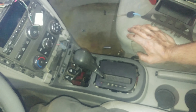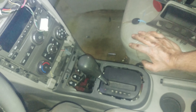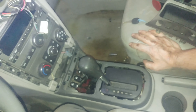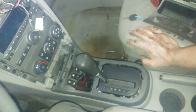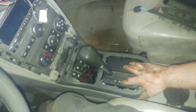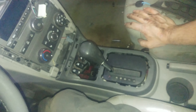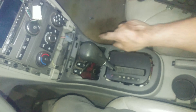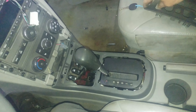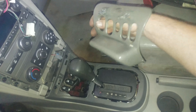Open up your back hatch first. I would disconnect your battery if you're doing this job. Open up the back hatch and disconnect the battery — leave the hatch open because it's electronic and you won't be able to open it with the battery disconnected. You'll also want to be shifting this into neutral, which also doesn't seem to want to shift without electricity — it's an electronic shift control. There are two screws here and it snaps into place otherwise.